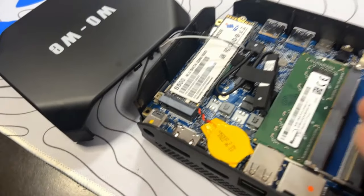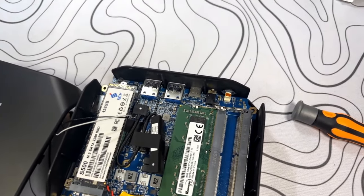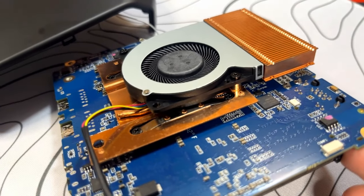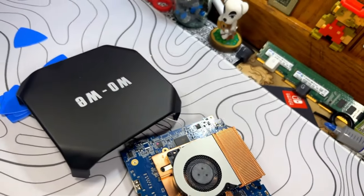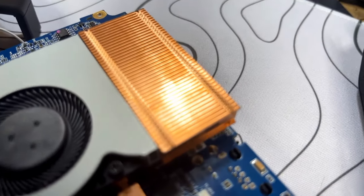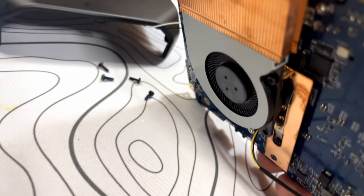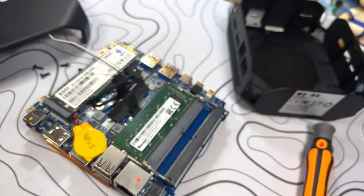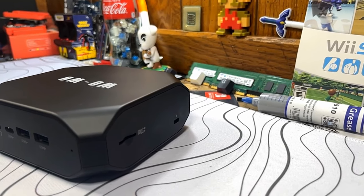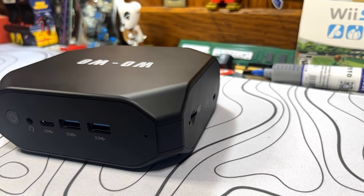Coming down here, we have 8 gigabytes of DDR4 — not a brand I recognize, but drop a comment if you do. I have a 16-gigabyte T-Force kit I plan on throwing in here. The cooling solution has no screws — once you get the top off, you're able to just pull the board out. The entire heat pipe is copper, which is typical of laptops, but the entire fin stack is copper as well instead of aluminum. It's pretty hefty and actually weighs a good amount. Even though this isn't a fast or new processor, I'd like to see how it keeps the CPU and GPU cool.